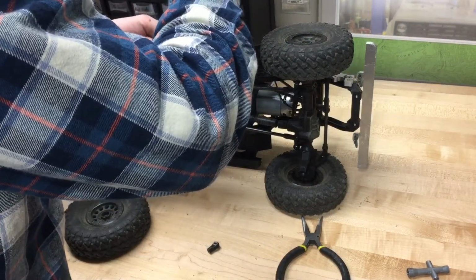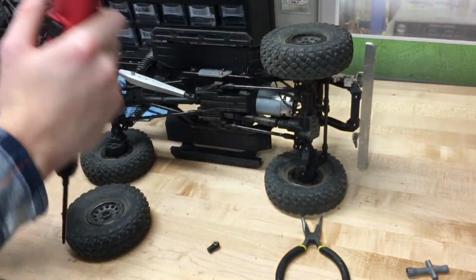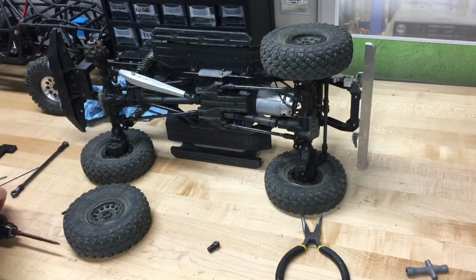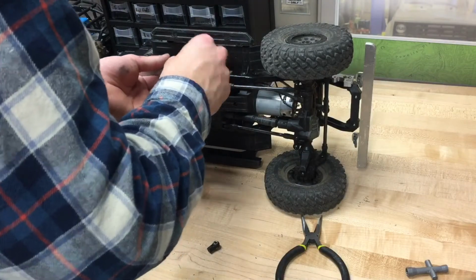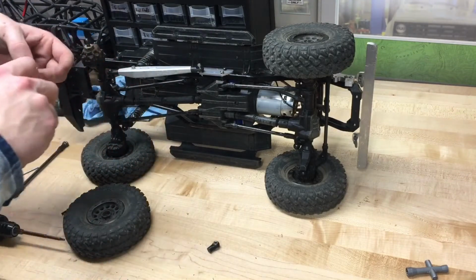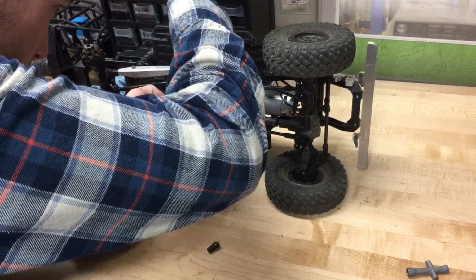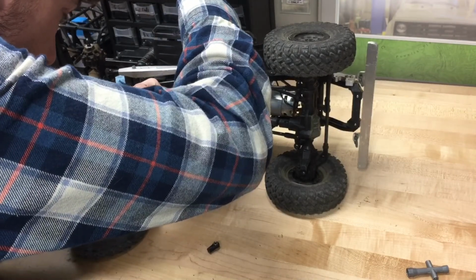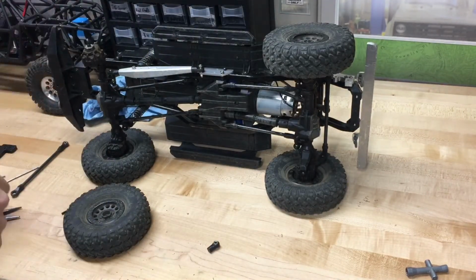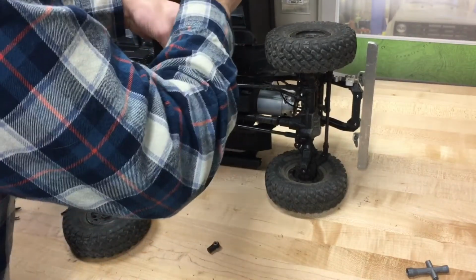Then we'll take a 25 millimeter screw and get it set in there and make sure we have everything aligned. And then you can tighten it down. We can attach the trailing arms with a 16 millimeter screw through the bracket and to a lock nut. And make sure you tighten the screw that we have on the top for the frame rail here.